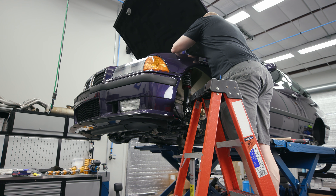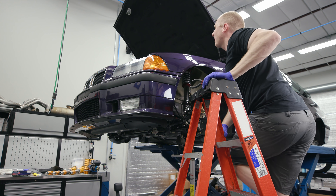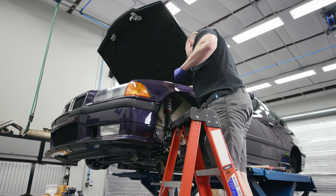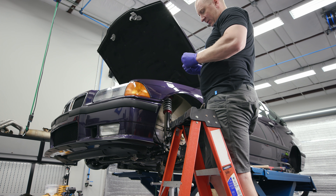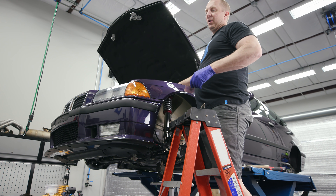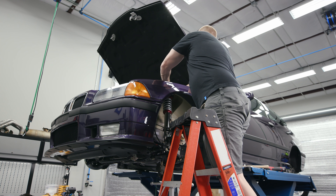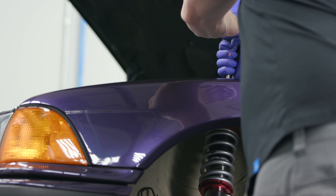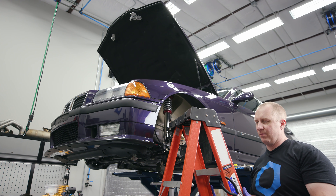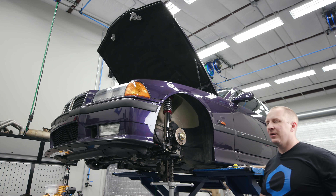Take the needle nose and pull it up through, but I'm going to have to compress it a little bit more — just to the edge where you start lifting up the car. Put a little Loctite on. Way easier than trying to use a spring compressor. They make it very clear on the camber plates that you do not want this torqued — just hand tightened. It's going to be under load, it's going to be compressed, so it's not going anywhere. You can't fit a socket on there anyway. So now we're going to torque the bottom bolts down and then start working on the brakes.